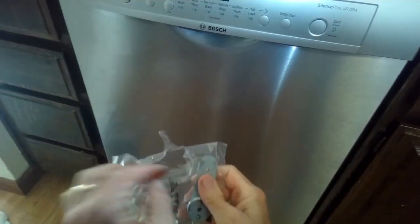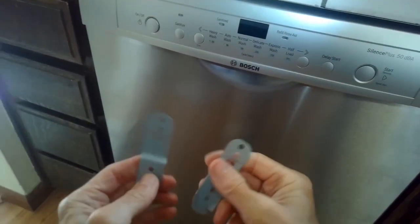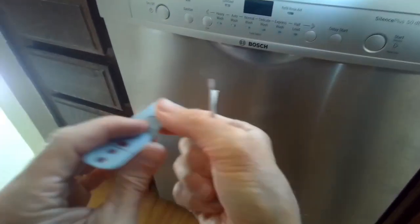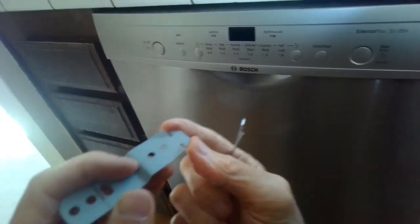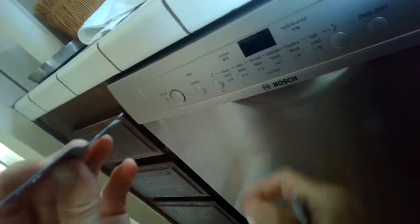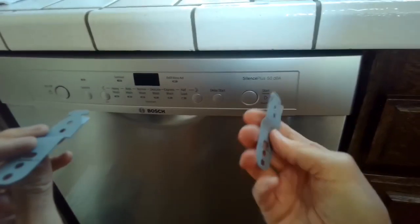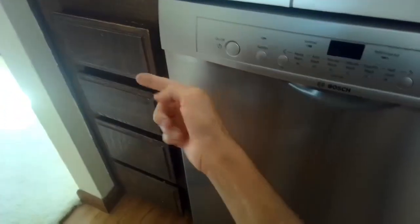For my install today, I'm going to put screws in from the side going into the wood. But sometimes you need to mount it to the top, in which case you use these little brackets that come with your dishwasher. These fit into the metal slot on the frame, then you bend them up and put a screw up into the wood to hold it in. You can go into the slot on both sides and use those brackets, but going in from the side is also pretty easy.